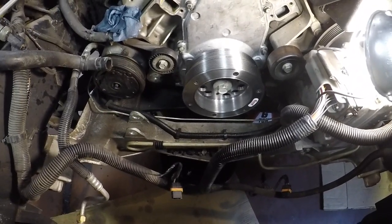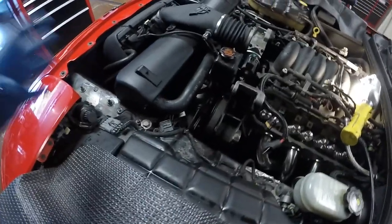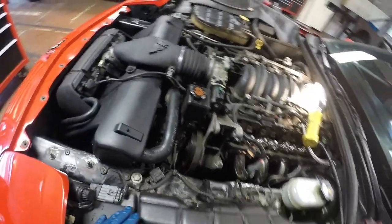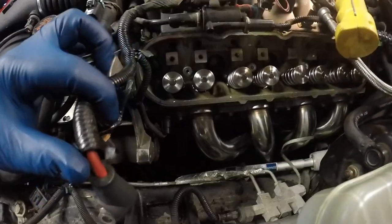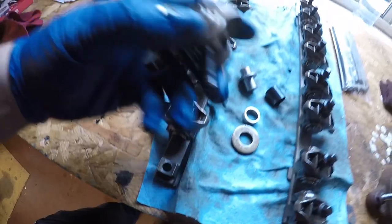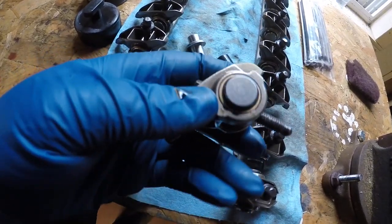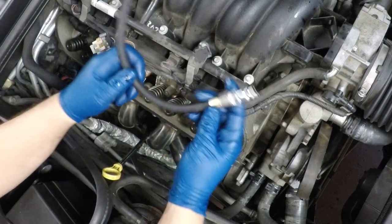Now we can go ahead and get the steering rack back in and start putting the front of the car back together. Everything goes in pretty much the same way it came out, so it's pretty simple. Next we're going to work on the valve train. I already got the driver's side done — new springs in there and I also did the trunnion upgrade on the rockers with the new brass bushings and snap ring. Now all I've got to do is the passenger side springs.